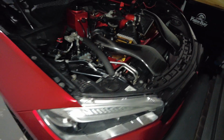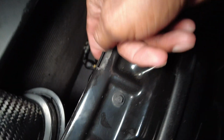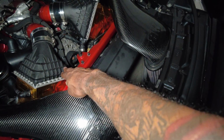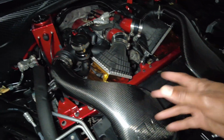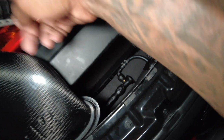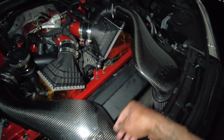It's just a setback, and I have to spend a lot of money to fix it. Money that was supposed to be going on rear axles and tuning this car. So now the car has no AC, and what is even worse is that to put the interchiller in down here, you had to remove the factory cooler that used to cool the intercooler. So now there's literally nothing to cool the intercoolers but whatever water is running through them back in the loop. When it runs through the chiller, it's supposed to be refrigerant going through that chiller to cool the intercoolers down. So now I have no AC, no way to cool my air charge, so the engine is going to be getting hot air boost, and no interchiller.